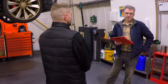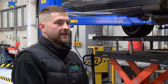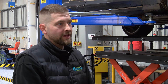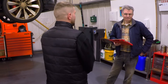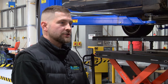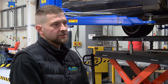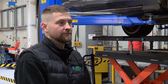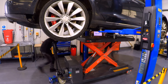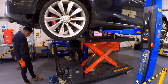What about changing the oil on the Tesla gearboxes? Tesla again say don't bother, but they used to recommend it. A lot of manufacturers say they have oil for life — it really depends on what they see as the life of the vehicle, which is often around 100,000 miles, not forever. Personally, I would get mine done more regularly than the manufacturer says. It's often the bare minimum standard they're trying to achieve to keep the cost of ownership to a minimum, but personally I'd do these things every five years, depending on mileage and use. Fresh coolant and fresh oil can certainly not hurt.